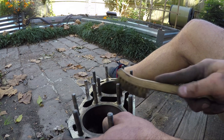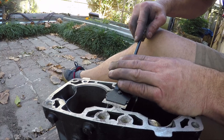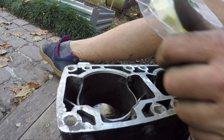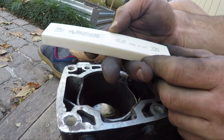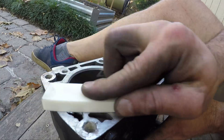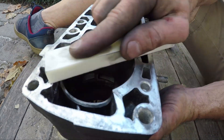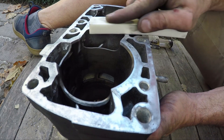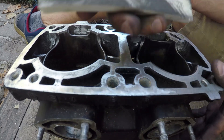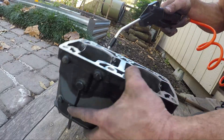Once the grinding and sanding was complete, I used a wire brush, razor blade, and sanding stone to clean the gasket material and other debris from the mounting surfaces. The sanding stone is helpful since it can span the face and ensure the flat surface is maintained. I inspected the cylinder walls and pistons, deciding not to hone or replace either.